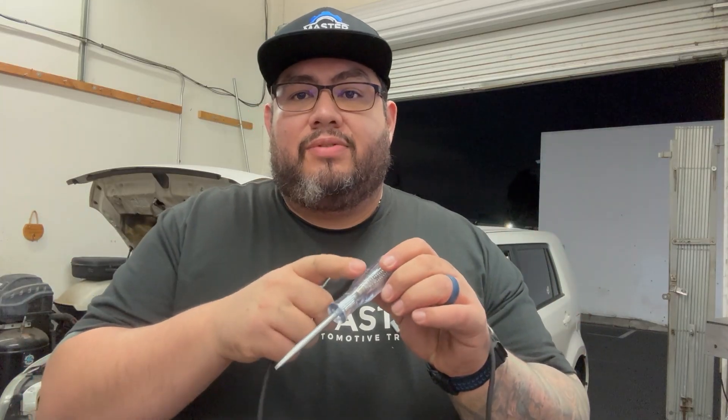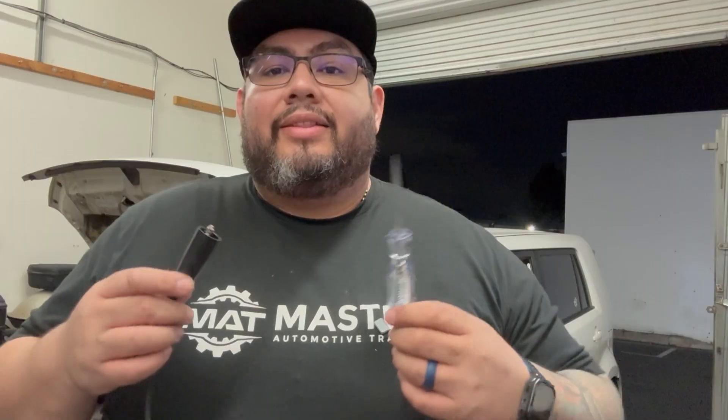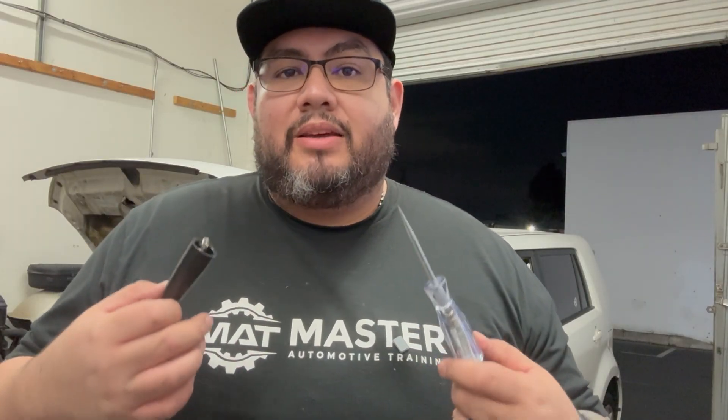If I'm going to use this in a circuit, I want to make sure that the circuit can sustain at least 223 milliamps. If not, I'm not going to use this light because I can damage the circuit. You can go to the ground side and then use this on the power side and that's going to give you a complete circuit and light the bulb. You can use this for other things as long as the circuit has the ability to sustain that load.